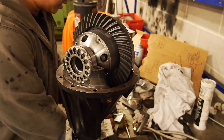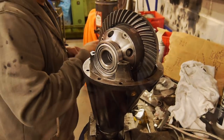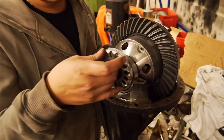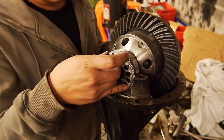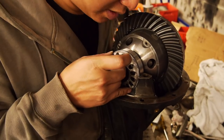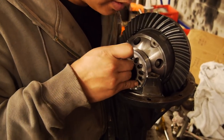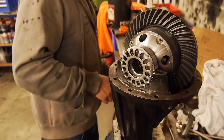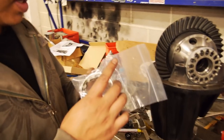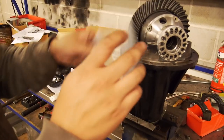So we've put out all our parts down here. I'm just gonna put some mounting paste on this as well. Okay, so I've got the bearings roughly centered. I'm just gonna place these. It doesn't have to be hard up against it, but we want to make sure that the threads are engaged properly. So does that look okay? That looks good. Alright, in the ARB kit you get two adjusters. They're different diameters, so you want to pick the right one. And there's the crucial spring clip.